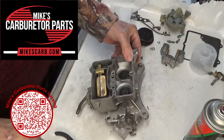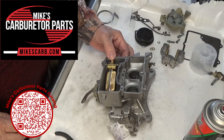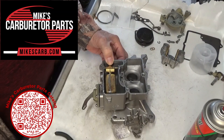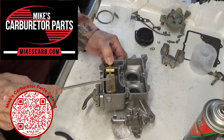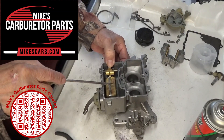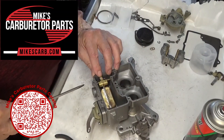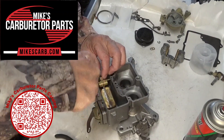This clip — the retainer — push it down and it clips into the groove built into that needle seat. As far as the float adjustment, I'm not going to give you a specific adjustment because it's different for different applications. Find your carburetor number, or look for the closest application you have, and check the instruction sheet that comes with the kit. You want to measure from the top of the float bowl to the top of the float. Don't adjust it while it's in here because you might put pressure on the needle and damage it.